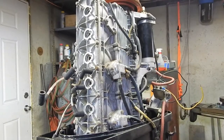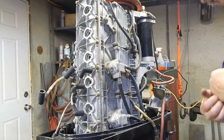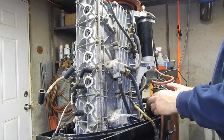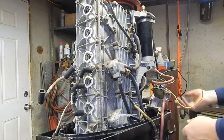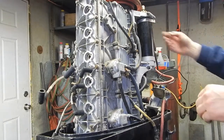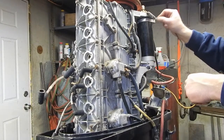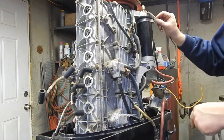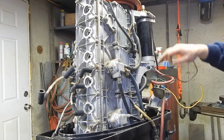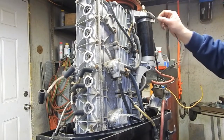Well, it took a little bit of fiddling with the wiring, but I got my temporary setup here. I got my battery on the floor with a charge on it. I temporarily just laid the bracket with the starter solenoid in here, and that's wired to the starter. I got a ground, so the solenoid has to be grounded. So I'm just going to hold this wire to the case of the... Can't hold it to the chassis because these rubber collars are probably isolating it.